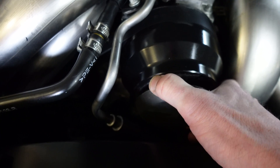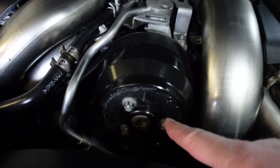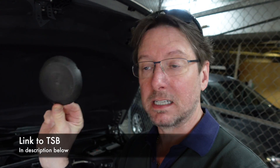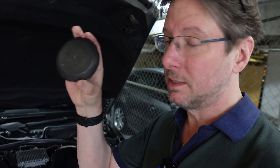It literally just pushes in here. It's the nastiest, cheapest little part you can imagine. All it does is cover up this end plate here — it's just cosmetic. It's such a cheap and nasty bit of plastic that Mercedes actually had to put out a technical service bulletin for this $2 piece of plastic saying if you're getting rattles from your ABC pump, take this cover off. So I did that and the rattling stops. I've ordered a new one from overseas, but really it doesn't matter — it's just a cover.